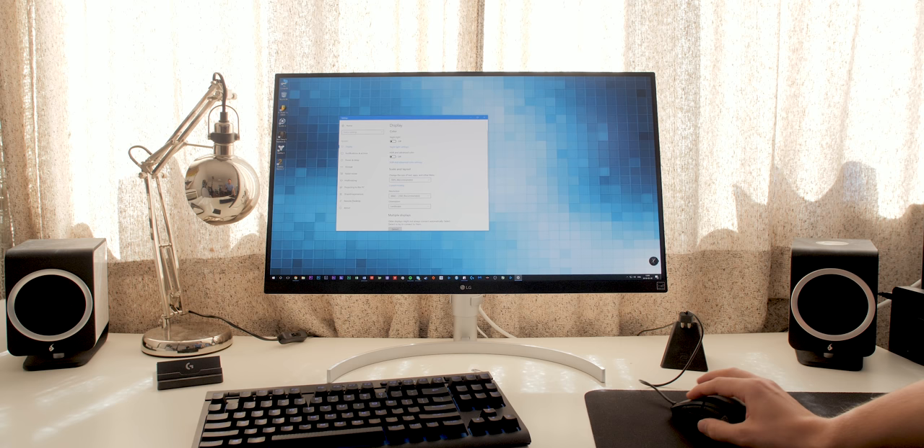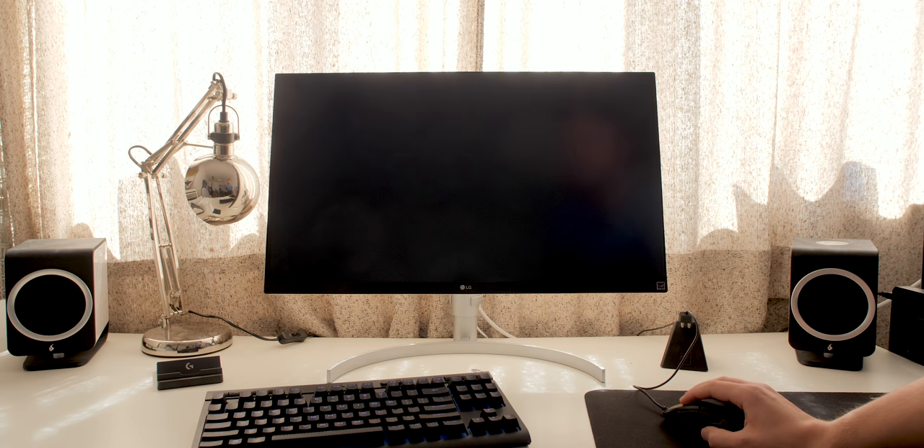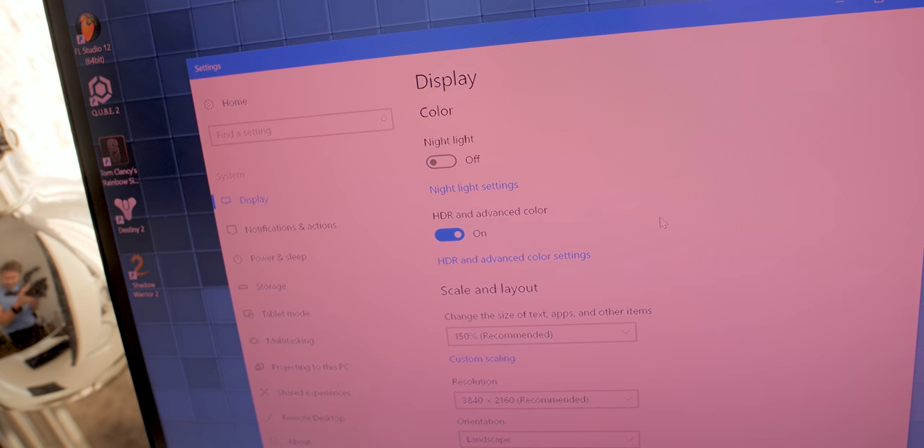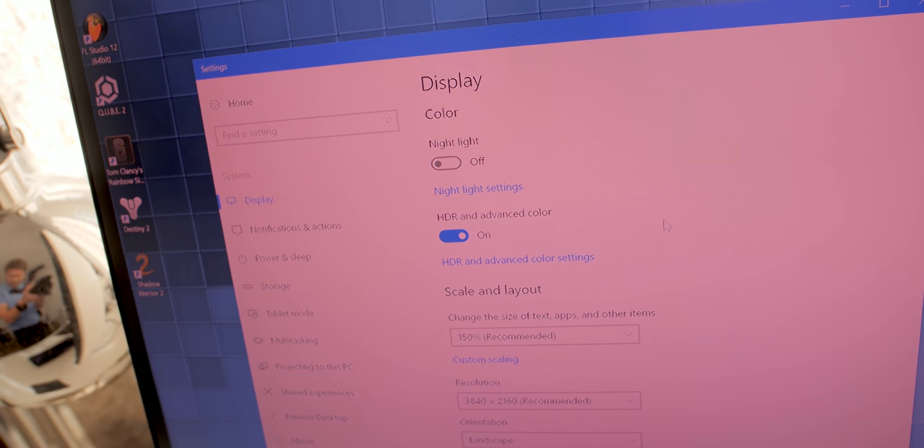It all kind of looks the same, and for certain games that looks fantastic, for others not so much. It would be so cool to see Dolby Vision supported games where it dynamically maps exposure, vibrancy, and tonal contrast inside a certain frame, rather than just slapping a vibrancy and exposure filter on top like HDR 10 does. The first experience with HDR obviously comes through the desktop — opening display settings and turning on that HDR toggle — and there's this pink blanket over my screen. That is the first bug I discovered. I have no idea why it's there, and it's been reappearing throughout my testing even with new drivers, reinstallation, troubleshooting in the Nvidia control panel, Windows color settings, and disabling my Spyder Pro calibration profiles.